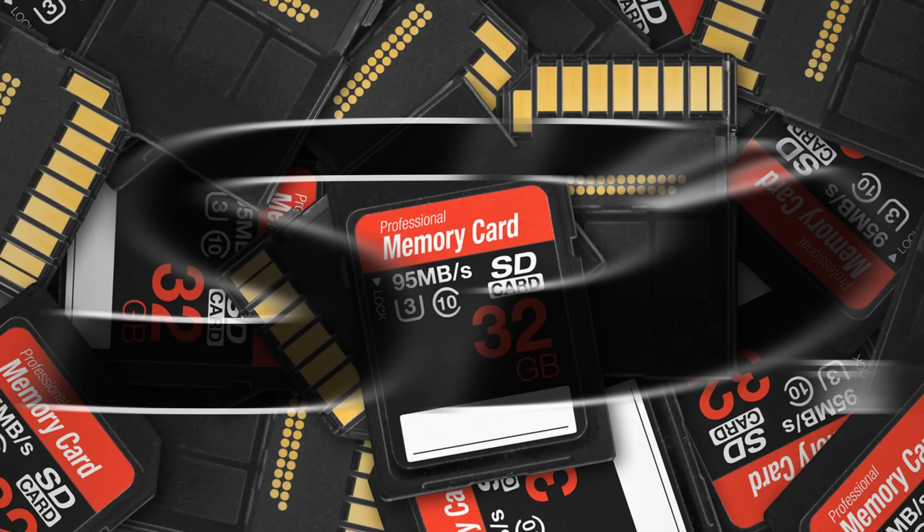So what became of the FlashPath, and indeed Smart Media as a format? Well, recordable CD drives and media were coming down massively in price around the turn of the century, and USB flash drives came about at the same time and really took off as USB started to become more ubiquitous. The last Smart Media devices were manufactured in 2006, and although 256MB cards were planned, the world had moved on by that point and so they were never released. Adding the extra flash chips to reach that capacity would have broken compatibility with older devices, due to the fact that the flash controller had to be implemented on a device-by-device basis. I should add that there were MMC and Sony Memory Stick versions of these adapters released later on as well — I do actually have an MMC version here. But of course they all eventually met the same fate, and nowadays SD, or Secure Digital, is pretty much the universal standard for removable flash storage — and I do think that's a good thing.